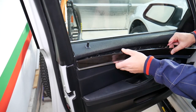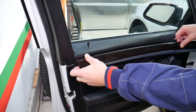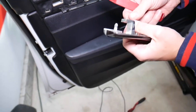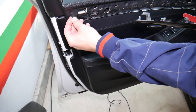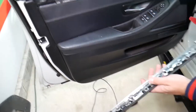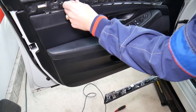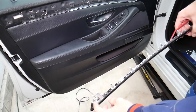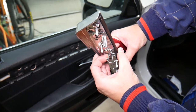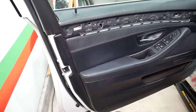One of the small clips fell out. Come in at an angle, go up, slide forward, and it came out. Two of the metal clips fell out, so I need to get them out and install them back on the door panel. I can see one right here — let me install that on the door panel. So that's the side clip right there. The metal clip over here — you come from underneath, press it, and it comes out.